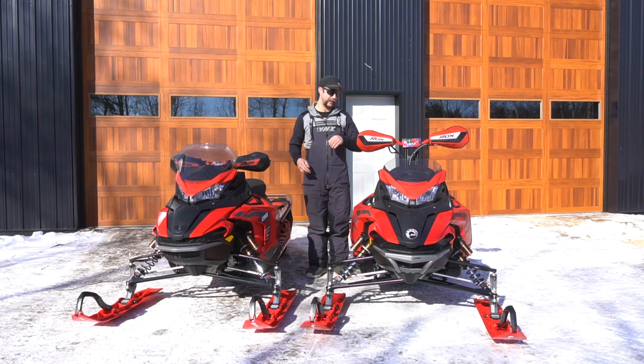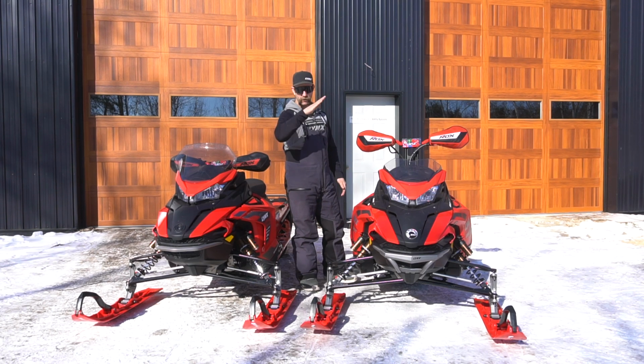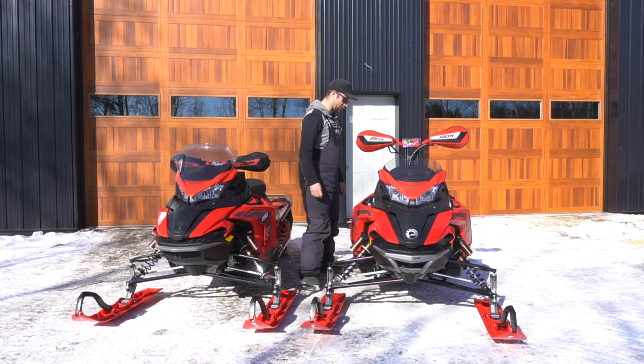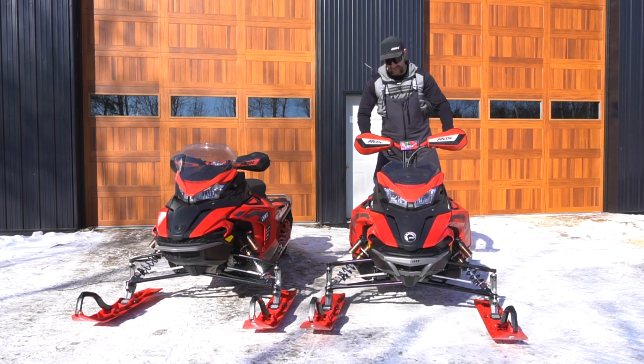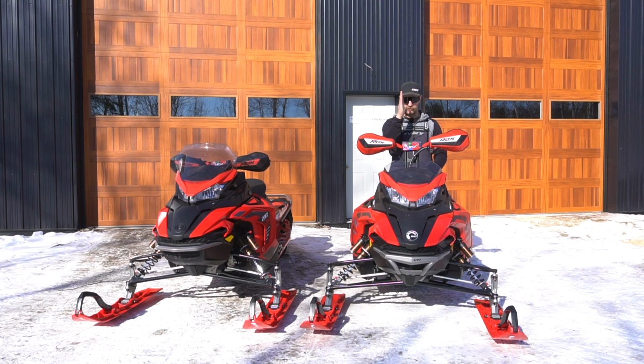2.5 inch, 8 inch. And it's tilted forward like I've seen the cool kids do, how they tilt the bar riser pretty much vertical for some reason. I don't know why yet, but we're gonna find out. It just doesn't make sense. You think you got more leverage up here, you don't. If you think about something moving back and forth, you have a lot less motion down here, a lot of motion up here.